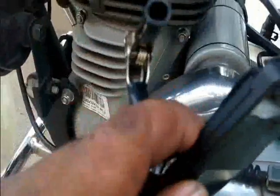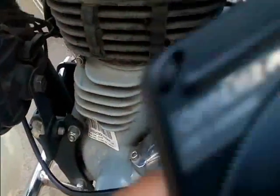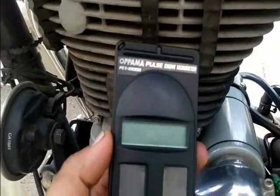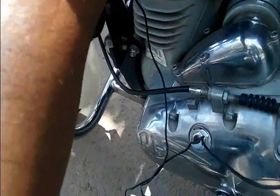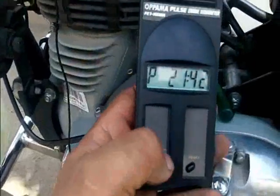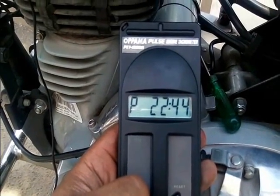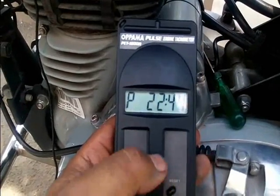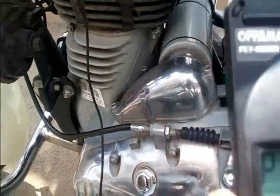Now I am going to use the wire for the RPM reading. This is based on frequency or magnetic field. I am going to attach the RPM tool. The setting 21.42 is basically for a single cylinder engine, and 22.44 is for a twin cylinder. I am going to use 21.42 — even if you don't set it, it will reset to 21.42 according to the pulse.